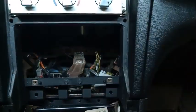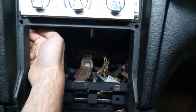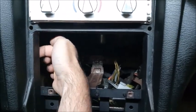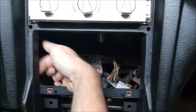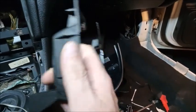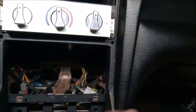Once you get it all done on the front side, put on some gloves, mix up some more epoxy, and then put your hand around the back and put it down the line where you had cut it. That way you can get coverage on the back side and also on those supporting pieces there. Pull your masking tape and let the epoxy dry.